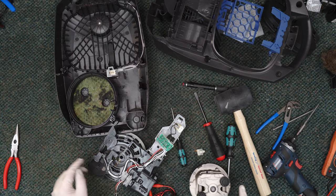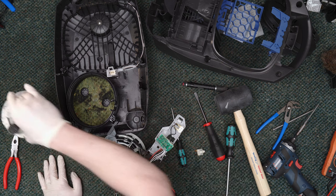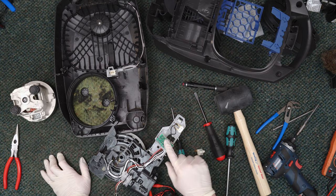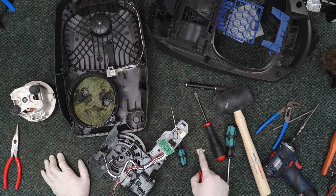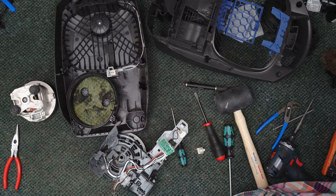We've tested the cord reel — it's good. We've tested the motor — it's good. The only thing it could be is this circuit board, which given the heat this went through doesn't surprise me. I really thought we were going to have one of these cord reels in stock — I typically stock one but I'm currently out. So we're going to have to wait to finish this until later. I'll button it up, let the customer know it needs a cord reel, and give them an estimate.